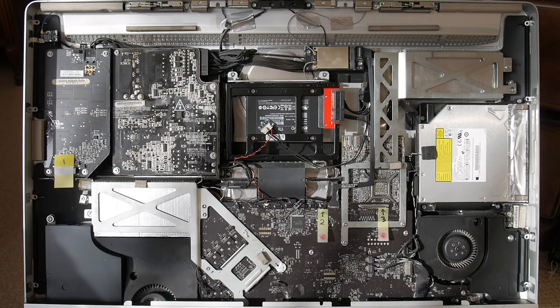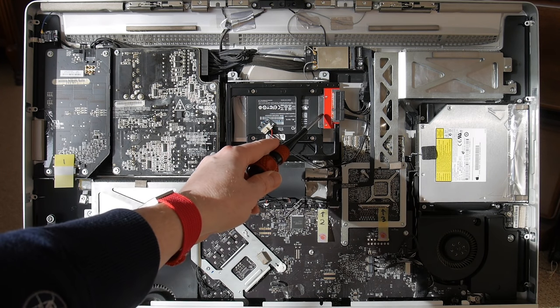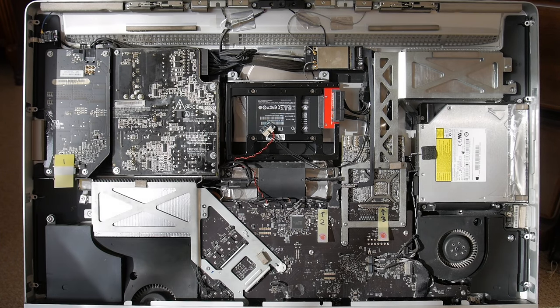The hard drive normally goes here. What you're seeing is not the stock hard drive — I put a Samsung EVO 850 1TB SSD in there. If you really want your 2009 computer to feel like something from 2015–17, you need an SSD. This SSD is compatible but requires a couple of options from OWC — MacSales.com, or Other World Computing — including a mounting bracket and this temperature sensor interface, so the fans won't always spin full blast. No special fan control software needed; it's all done in this little hardware module.